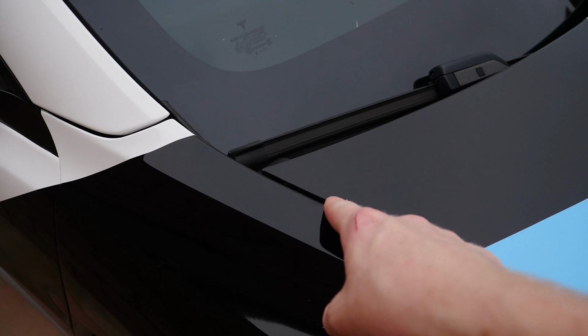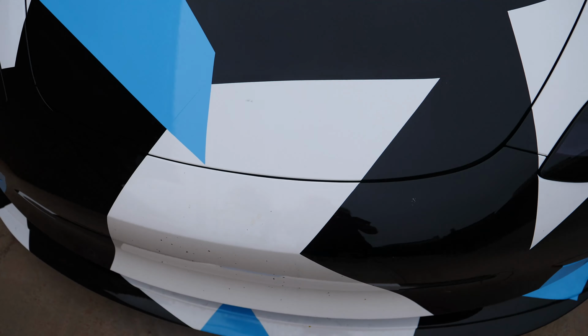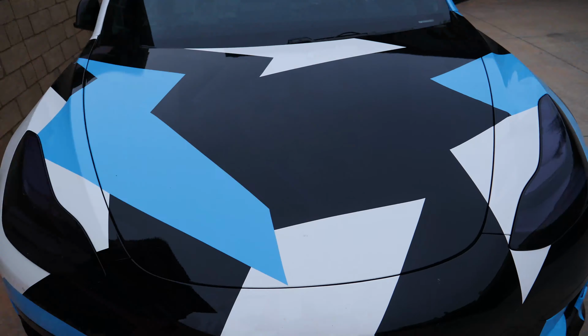And why I say 2 people is because one person has to get it there. When you get it there, they will retighten at least 1 bolt, and that should tighten it on each side, and then you will be able to crank all the bolts down after that. Pretty easy. I actually did it because my hood was badly misaligned right here, and it definitely looks better. It's now even on both sides.